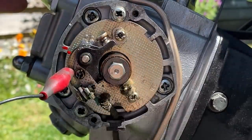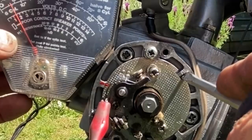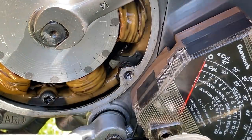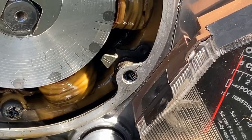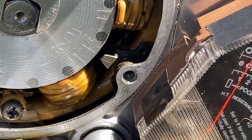With the crankshaft set at the firing position, the next thing to do is loosen the 2 screws securing the points plate to the engine and adjust the points plate with a screwdriver until the needle just moves. Then retighten the 2 screws securing the points plate in position, go back to the crankshaft, rotate it back past the firing mark and back up to the firing mark, watching the gauge, and as you approach the firing mark, the needle moves and the timing is set perfectly.